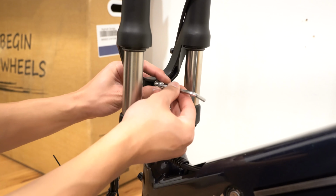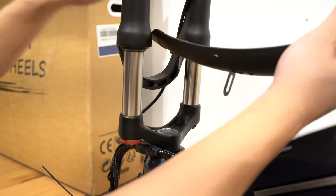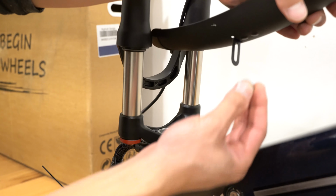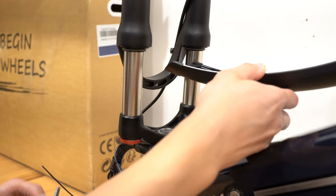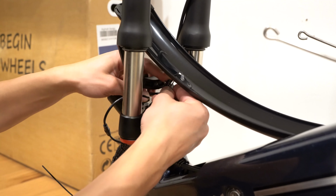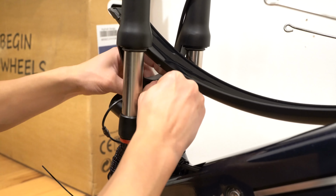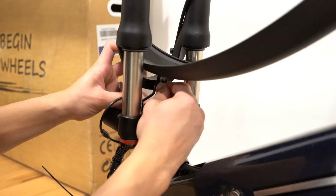Using your Allen key, you're going to take this bolt and washer off. Next, you're going to take your fender. This is the short side. We're going to put our bolt and washer through it. And then over here, we're going to have the headlight facing forward in the upwards direction. With this assembly, I'm going to have the bolt and washer and fender assembly bolt through the headlight bracket and then tighten this on